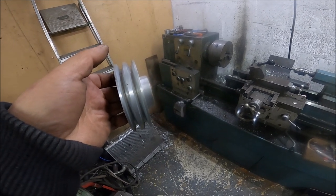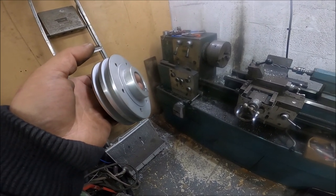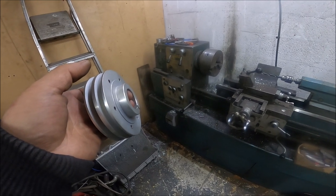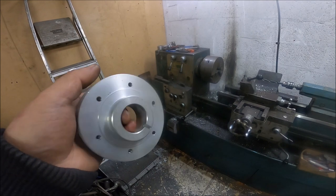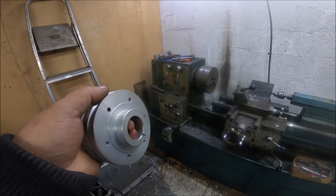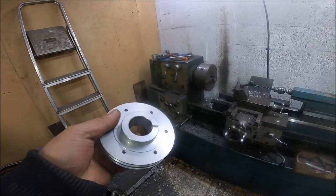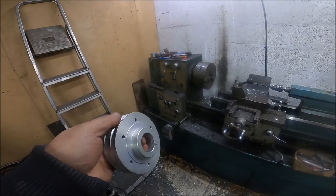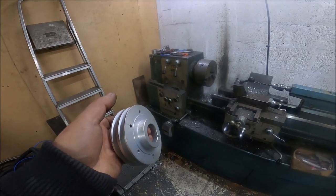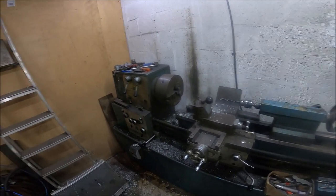All it's going to be running is the alternator. Most people say engines need crank dampers — that's what these things at the front are — but on these Volvos, these red blocks, it turns out generally not really. Some people say you do, but a lot say it doesn't make any real difference. Lots of engines don't have big dampers hanging off the crank pulley. This one is aluminium anyway, not the original heavy rubber-damped unit. Earlier red blocks didn't have any damper at all and they're still alive, so yeah — I'm going with no damper.